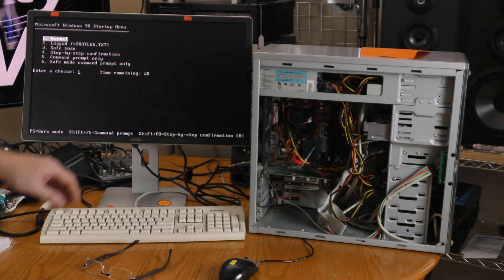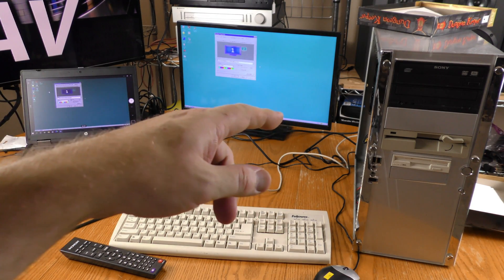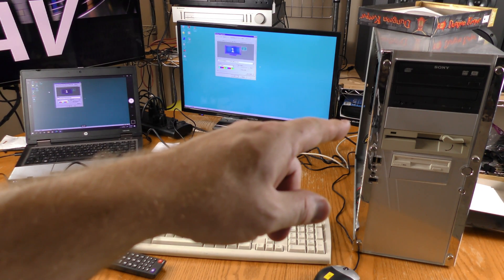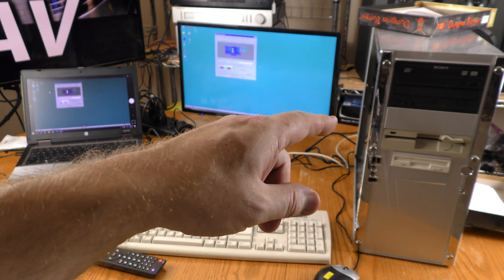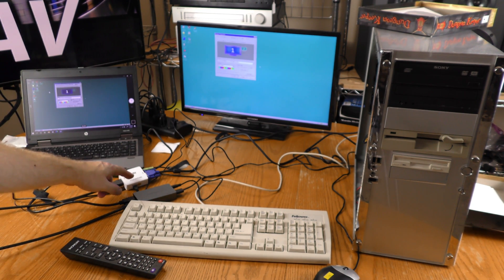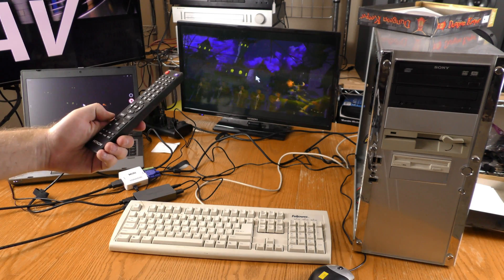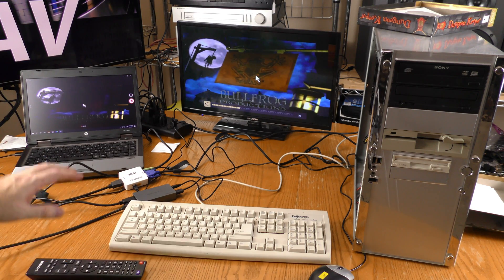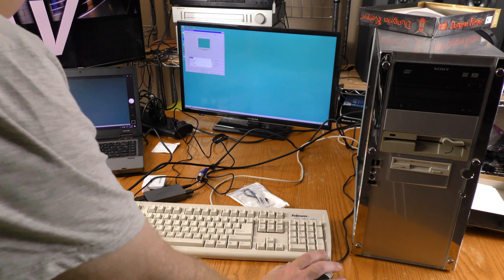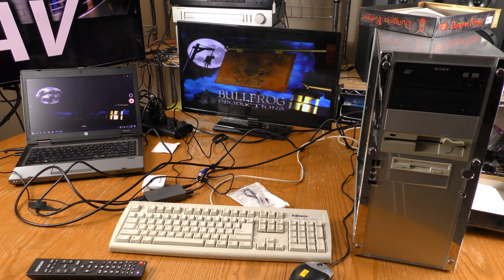I've been working with this Windows 98 machine, trying to get the screen resolution as high as possible. This Windows 98 machine is set to 1920 by 1080 — as high as the video card will go. I'm feeding that into the mini VGA to HDMI, and the output is running into my BuyEasy HD video capture device, which is running into my HP ProBook and looping into a TV set. I recorded the entire Dungeon Keeper intro along with some gameplay using the mini VGA to HDMI adapter, then switched over to the generic black VGA to HDMI adapter.